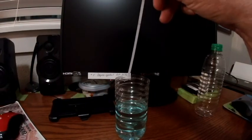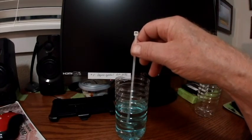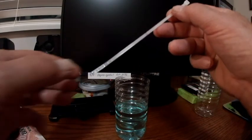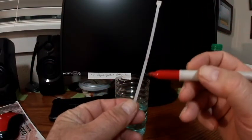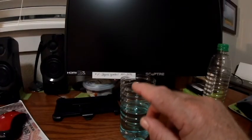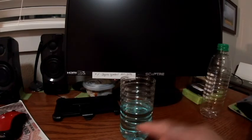The way I measure the height of the fluid is I stick a stick down in it, then I pull it out and you determine where the wet part is. I'm going to stick it down the fork to the top of the crown, and pull it out where that line is. You measure the distance — it's supposed to be 80 to 85 millimeters. If it's less than 80 to 85 millimeters, you get a syringe and suck some of it out. And obviously if it's too low, you just add.